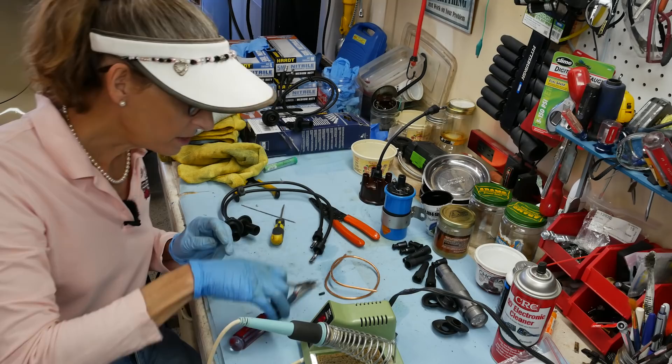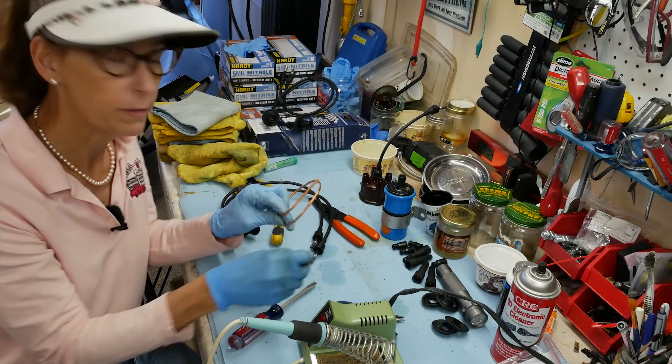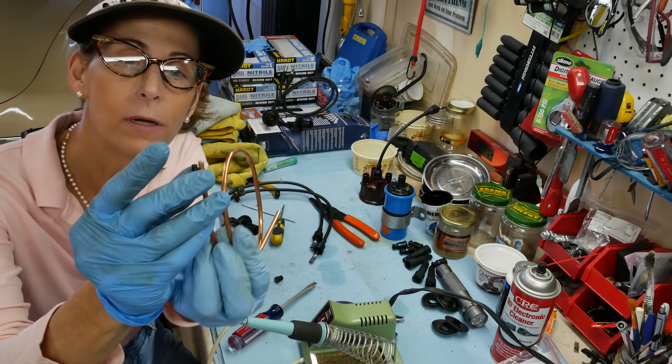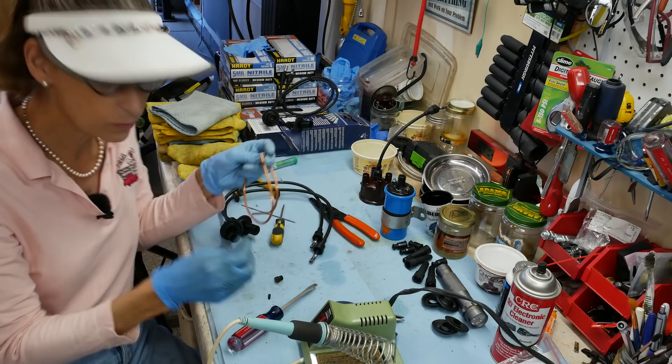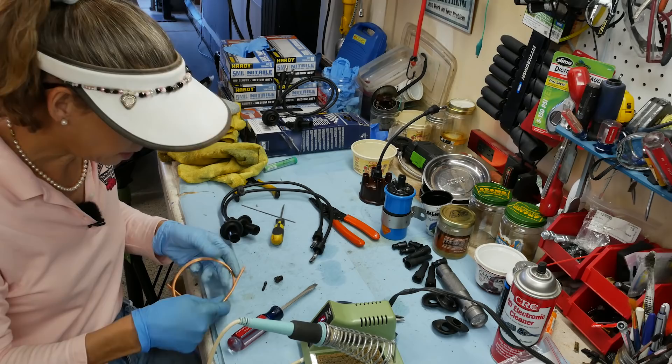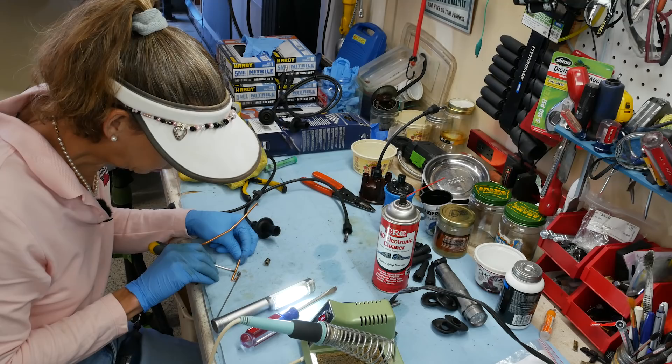This little guy is the resistor that was inside there and the end of it is all chewed up. It seems funny that one single plug would have a resistor and the other three wouldn't — that doesn't make any sense. So what I'm going to do is replace it with some solid copper wire. It's basically the same diameter, so this should work great. I need to know roughly how long it is, but there's a spring in here so I don't have to be too exact. I'll just cut it to length — the trick is getting the end nice and flat.